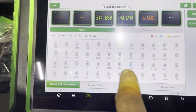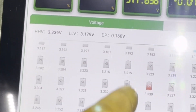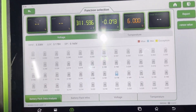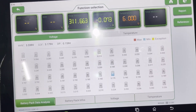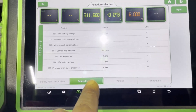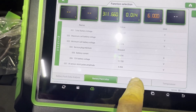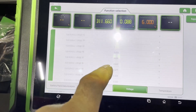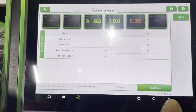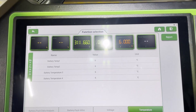It's showing all the different voltages here. The blue one is the minimum and the red one is the maximum. By doing this before you fit the battery or before you buy the battery, it gives you a good indication of how good the battery is. We can get some more information — the total voltage again showing the maximum and minimum, and a few other bits. Here is showing the voltages again, and here we have the temperature. That's what's available on this particular car, but depending on the make and model you might have more information.